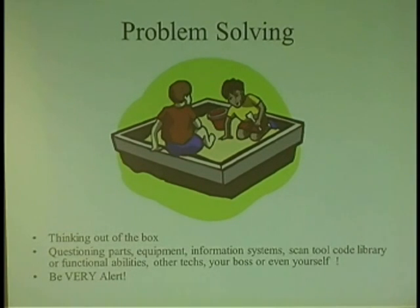The guy worked on a Bank 1, Sensor 1, O2 sensor on a Nissan. That's the one that has the exhaust manifold, and they split it in half. They make the front Bank 1 and the back Bank 2. Well, I don't know, just put one sensor and make Bank 1. But they split the manifold in half, and they screw one over here for cylinder 1 and 2, one over here for cylinder 3 and 4, and they call this Bank 1, and Bank 2.